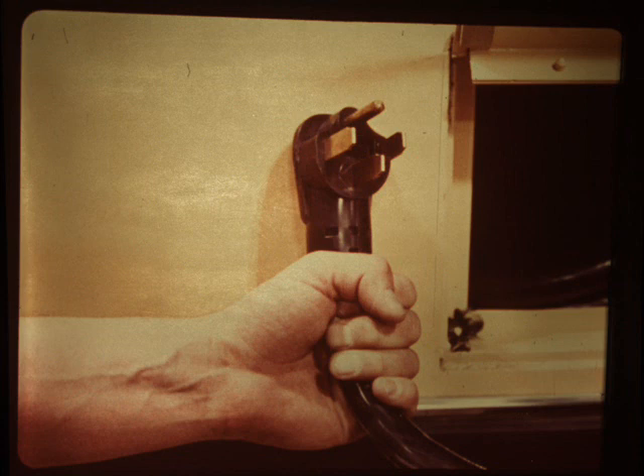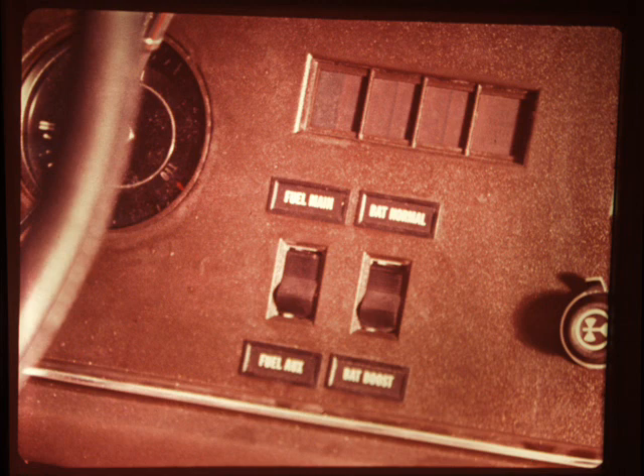At a campsite, the external electrical hookup brings 120-volt AC power through circuit breakers to provide power for the 120-volt AC circuits and through the converter for the 12-volt DC circuits. The converter changes the 120-volt AC to 12-volt DC and also functions as a 12-volt battery charger. The motor generator cannot provide power unless the external power cord is plugged into its receptacle. If the battery boost switch on the instrument panel is left in the bat normal position, the living area circuits will not drain the automotive battery. With the switch in bat boost, the batteries can be used together to start the vehicle or run the living area circuits; it is recommended that the switch be returned to bat normal afterward.